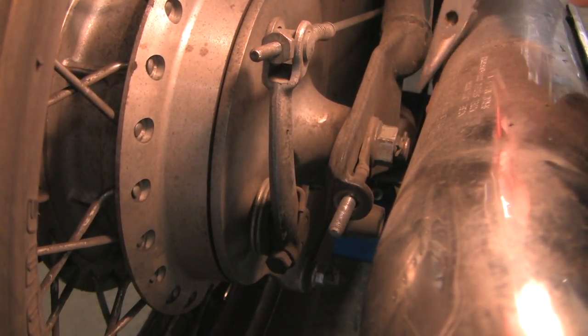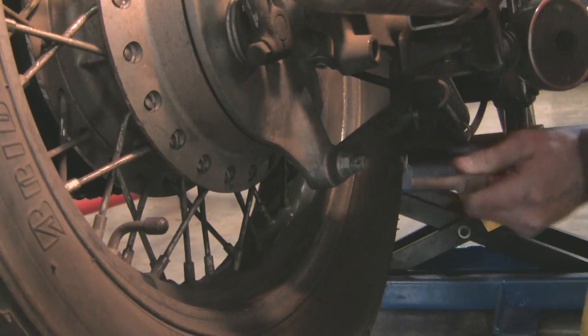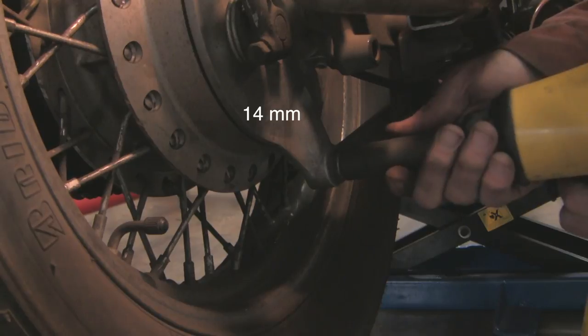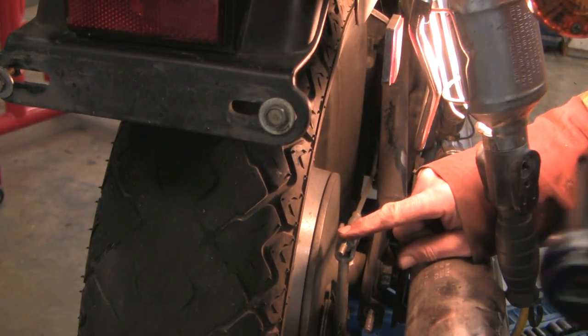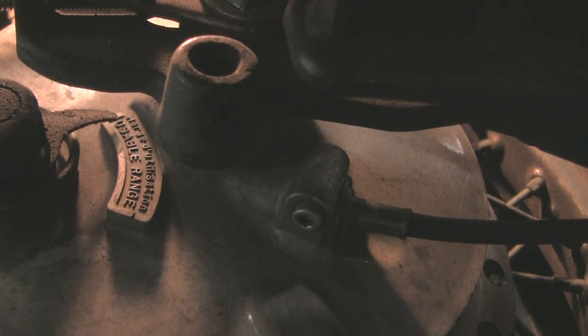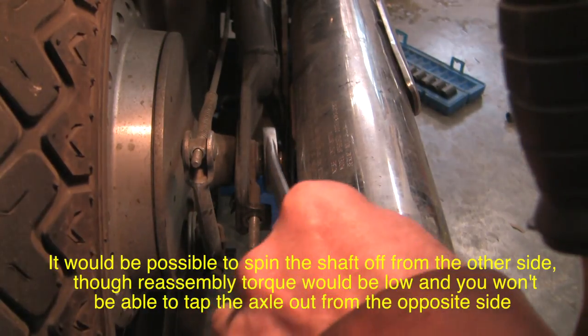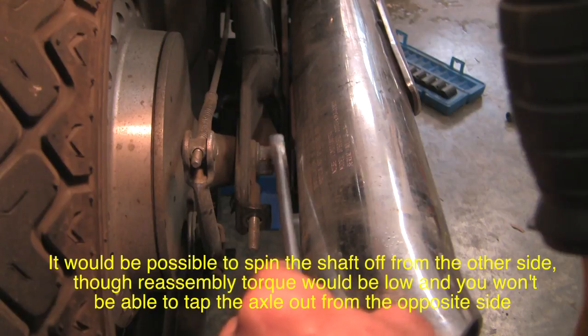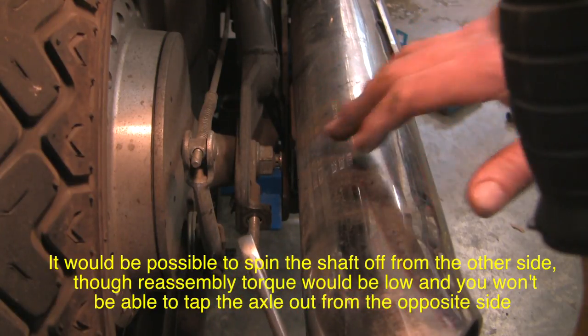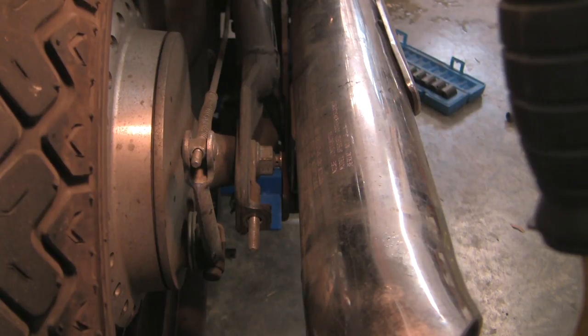There's a cotter pin right here. They call this the torque link nut - here's another cotter pin. This is the brake rod and the rear brake adjusting nut - we'll take that right off. Next we have to unhook the speedometer cable; this is a 3 millimeter allen screw. I wondered why we have to take the exhaust off: one reason is there may not be enough room to spin this nut out against the bracket, limited by the exhaust. And secondly, how am I going to get a torque wrench on that to properly torque it? I'm going to take the rest of the exhaust off to make it easier.